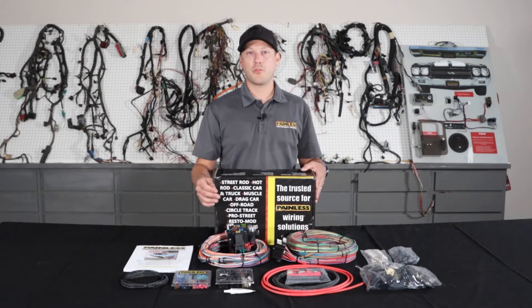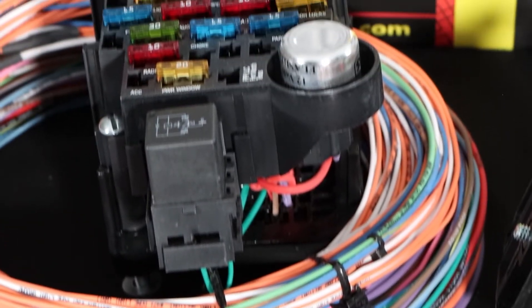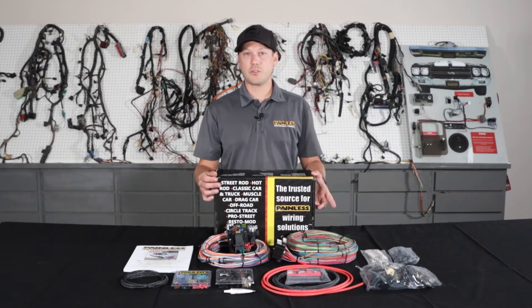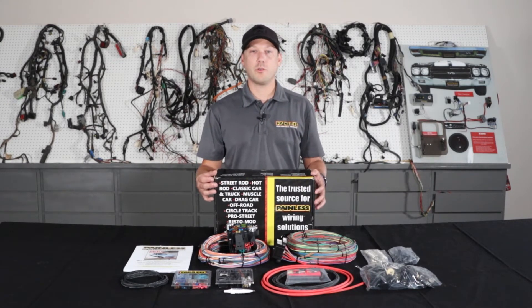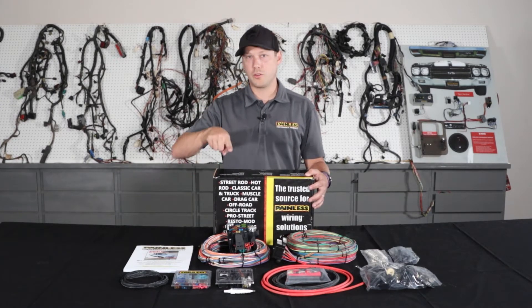With the Pro Series line, we offer an 11-fuse 23 circuit or an 18-fuse 25 circuit option. So if you're doing power windows or power locks, we have the bigger fuse block. We offer it with the grommet pass-through, and also with the bulkhead connector that GM used in 68 and up vehicles. We also offer a pickup version with the bulkhead that passes all the tail harness wiring through the bulkhead so it goes along the frame. These harnesses include a 6-gauge charge wire and a midi fuse to protect the system, so they'll handle any high amperage alternator.